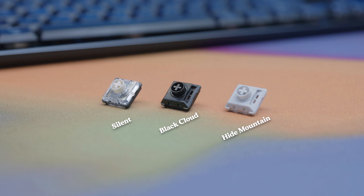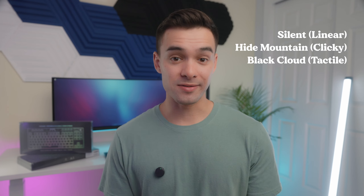Now let's dive into the switches. Each board comes with KL low profile switches, all engineered to have a low reset point, which comes in handy for rapid presses — important for gaming. You get a choice between Silence, which are linears; Hide Mountains, which are clickies; and Black Clouds, which are tactile. I've been using the silent linears for the past week or so — I've always been more of a fan of linear switches. They're quiet but also feel really nice. If you're a streamer or work in an office, you'll want these so your mic doesn't pick up clickies. But it all comes down to your use case. Let's jump into the sound test so you can determine which switch you like the most.